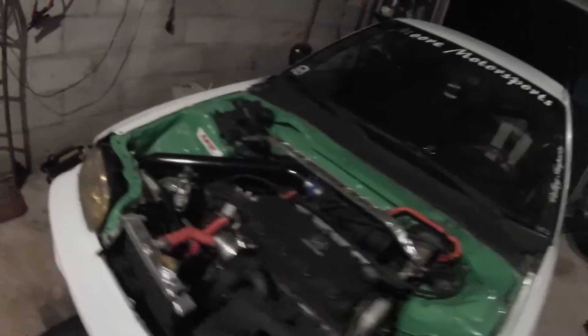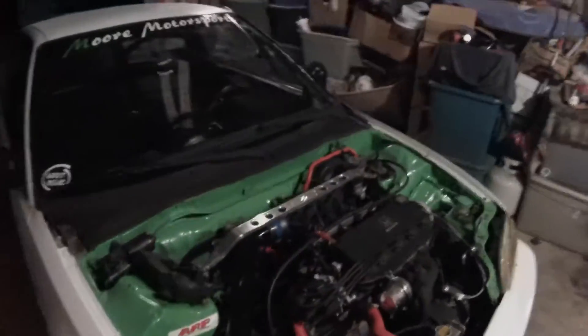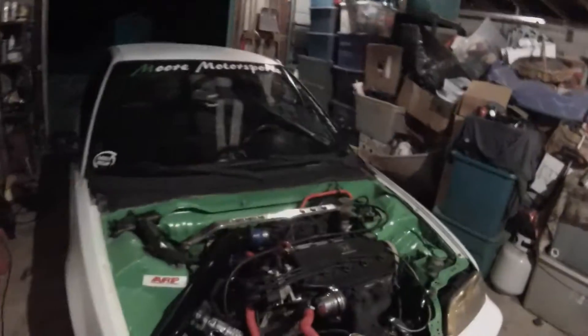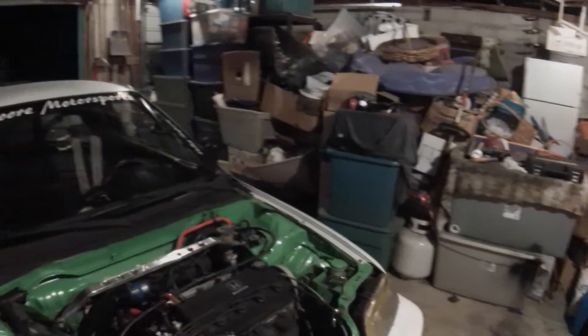It's going to have no power to me, but it's come a long ways and it has a ways to go still — 25 pounds next summer. This winter I'll keep you guys updated on the build. I'll actually probably have a how-to build motor video, because I'm probably just going to tear it all down. I'm actually probably going to go bore 60 over instead of 20, get bigger pistons, refresh the bearings, and get the crank checked over to make sure it's all top notch for next summer, because I'm coming out hard. I'm hoping to shoot for 11s or 10s if possible — 10s I think might be a little out of reach, but I should be in the 13s right now as it sits. My buddy runs 14 flats and I can beat him, so I should be at least a high 13, maybe a mid, hoping for lows.